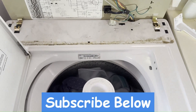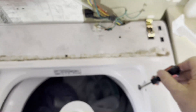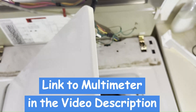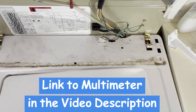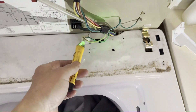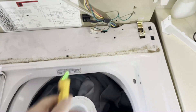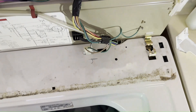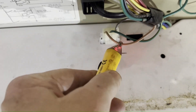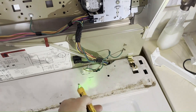I'm back with the washer lid switch replaced. This is what happens when you press the lid switch now — the washer does go into spin mode, so the lid switch was definitely bad. I'll show with the voltage pen what those readings look like. Before you press the switch it's just like before — no closed circuit. Now both sides light up, because it's impossible to have a 120-volt difference across a closed switch. Both sides light up, and that is the reading you get across a closed switch.